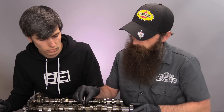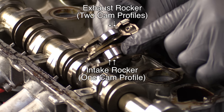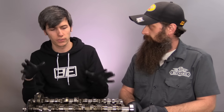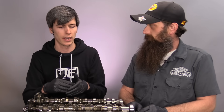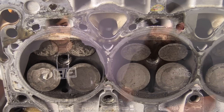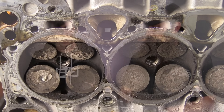This will have two valves per cylinder, so you'll have a rocker here as well as a rocker here — a pretty narrow rocker to ride on both profiles. The interesting thing is that this is on the exhaust side, not the intake side. This is a turbocharged engine, so you've got pressure pushing in air — it's fairly easy to get the intake charge — but it's difficult to get all that exhaust out. At higher RPM and higher loads you want to open the exhaust valves more to get that air out, reduce losses, and create more power.